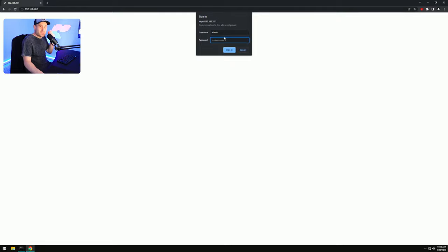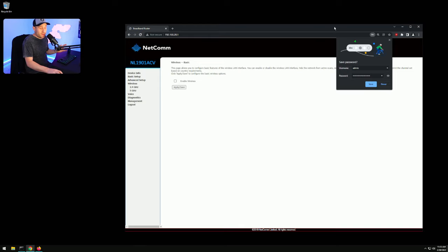You should now be able to log into your router's page and configure the settings. If you haven't set this up, look at the back of the modem router for the default username and password. If someone has changed it, you may need to do a factory reset — usually there's a small button at the back, sometimes requiring a hairpin.